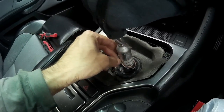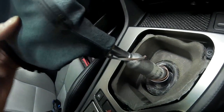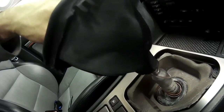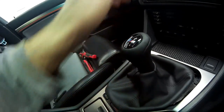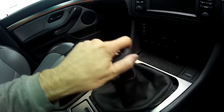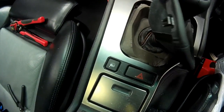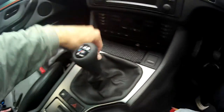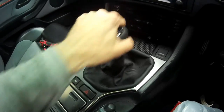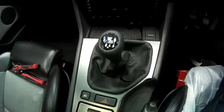That's illuminating very nicely. Once you're happy with that, tidy up the wiring and feed it back under the foam so it comes up the side of the gear lever. Push the gear lever firmly home ensuring you don't trap any wiring, and pop a bit of tape around the connections to make sure they don't vibrate loose through use of the gear shifter. Give the wiring a coil around the lever itself, then turn the shift boot inside out as far as it'll go - this will allow you to slide the gear knob firmly home onto the lever and give it a good hard tap at the top. Clip in the plastic surround on the bottom of the leather gaiter into your trim, making sure it's all clipped in and pushed home firmly.